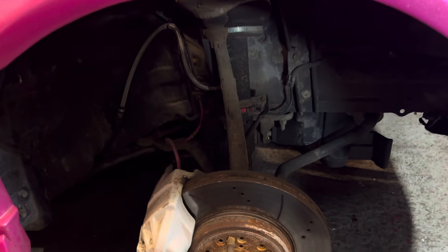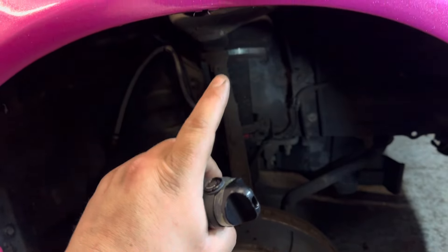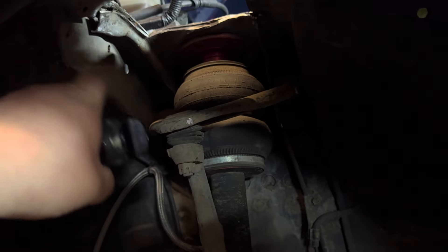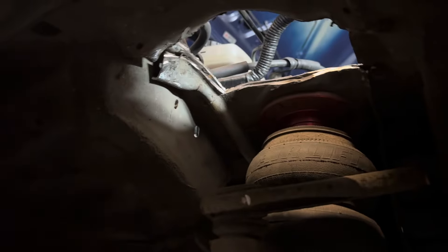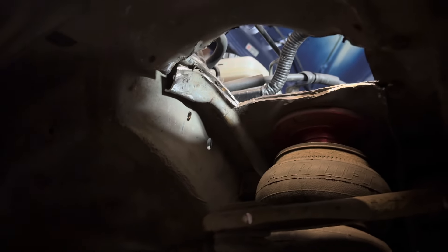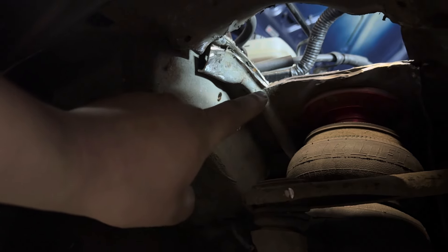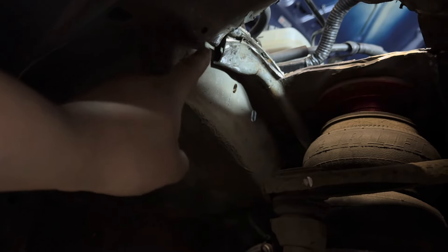What I had to do was drop the bottom bolt out of the struts to allow the arm to come down further, so I was actually able to get the grinder in from the inside. Where these are double-skinned, I'm going to need to get my dad to weld them together, and same with the old support bits — get them extended and welded together again.